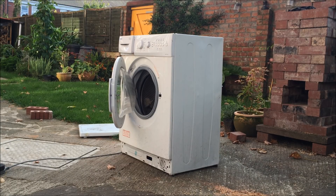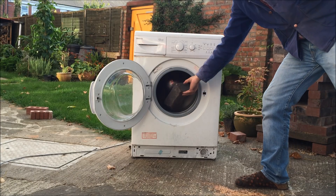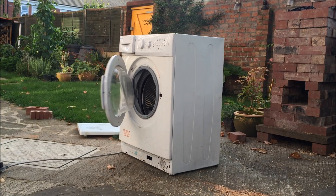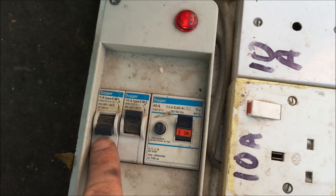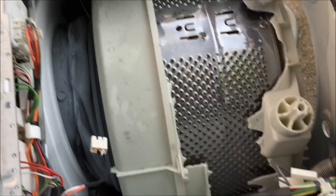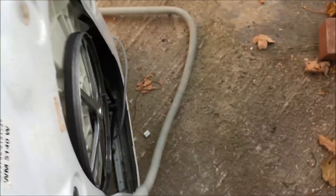Wow, well that was impressive - it blew the fuse, blew the top off, and kind of jammed it somehow. Over here we still have power but it tripped the overloading switch - tripped the MCB, miniature circuit breaker - so it had an overload of power. It's only on 5 amps. Let's isolate it from the supply before we take a look. Whoa, it completely tore the tub apart - it's completely seized, this is never going to run again.